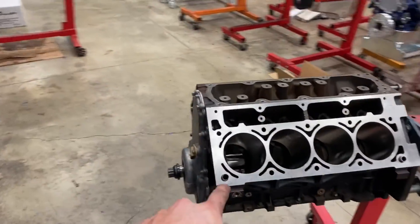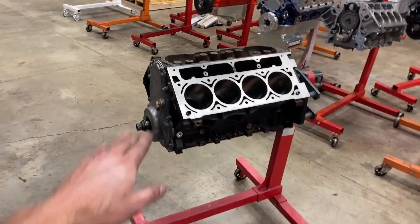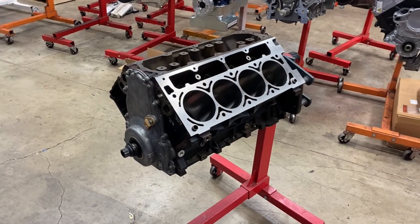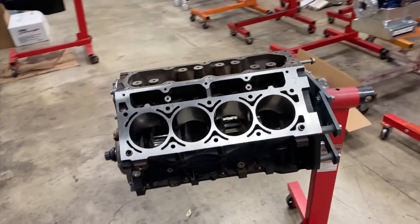That pretty much wraps up part one of this LS3-converted 6-liter engine build. Currently with a stock LS3 head gasket, we're sitting right at 11.0-to-1 with the cylinder heads he wants to run, which have a 68 cc chamber. I'm going to get with him and weigh his options — do we want to go thinner head gasket, how much compression do you want, what are the goals. We can either mill the heads down or squeeze it a little with a thinner head gasket since we have 45 thousandths quench right now. We can go down to 40, possibly 37–38 if it's going to stay naturally aspirated. So I'm going to get in touch with him, we'll come up with a game plan, and I'll see you guys next time.